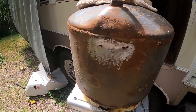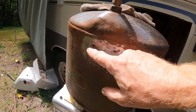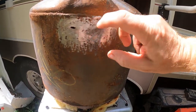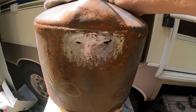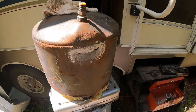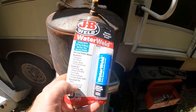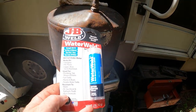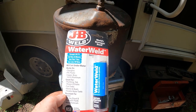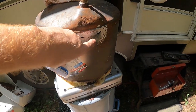I ground away a little more and found another hole right here. It looks like this whole area — maybe the camper moving has been beat up against the wood underneath it — has worn away right there. The hole is getting a little bit bigger, so I don't think I can even weld that. I probably could find a piece of metal and wrap around there and weld the whole thing, but what I'm going to do is go the simple way. I got some JB Weld called Water Weld — it sets underwater, it's for boats, it can hold 9,000 psi, and the cure time is one hour. I'm going to go ahead and put the whole tube on here starting here and press it in.